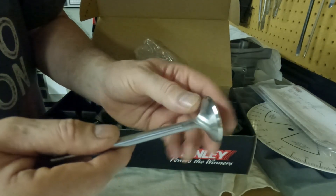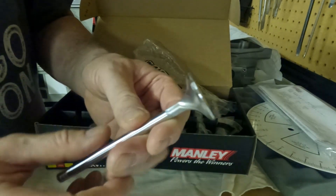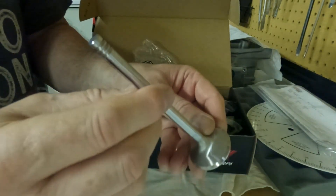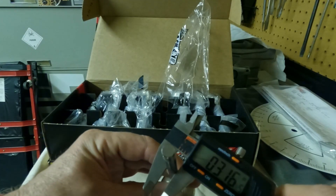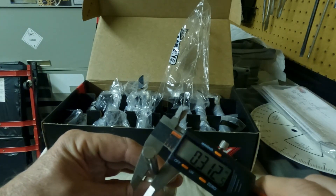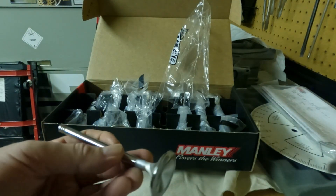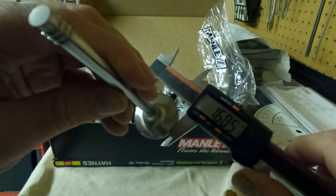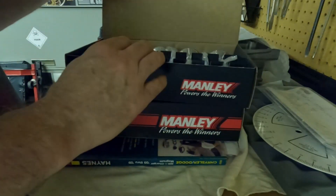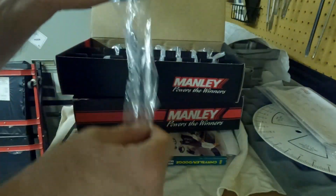There's a swirl polish on the back of the head, a nice smooth polished face with a 20 degree dish. There's your valve seat, which I believe is a 45 degree, and hardened tips. The exhausts are made of XH-426 stainless steel. I measured every one of these and they were very consistent, with virtually all of them coming in right on the money at 0.3125 — that's down to ten thousandths of an inch — and 1.555 on the head diameter as advertised.